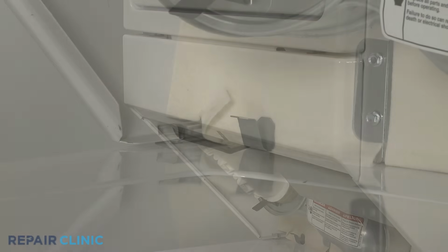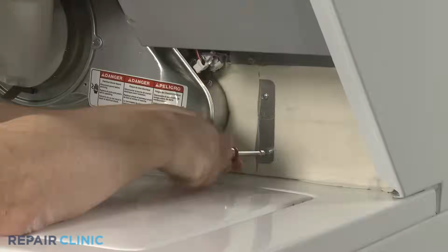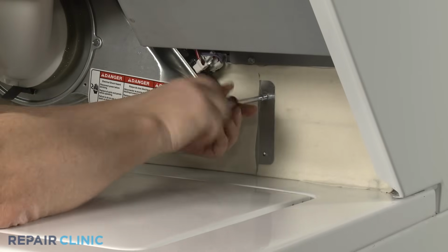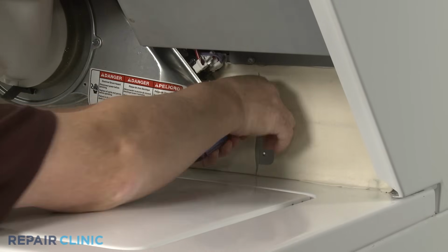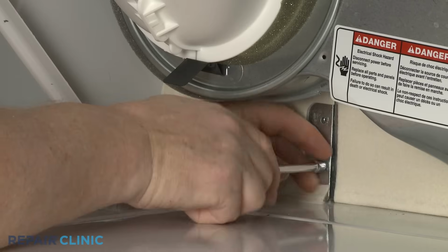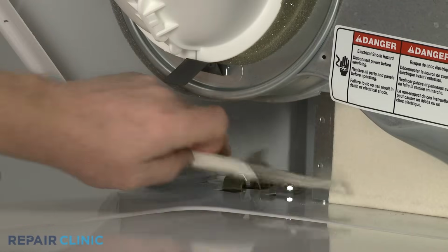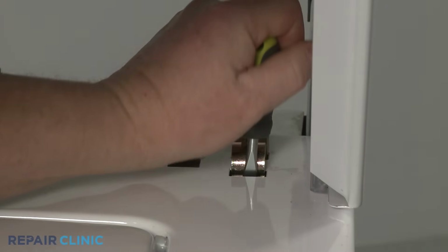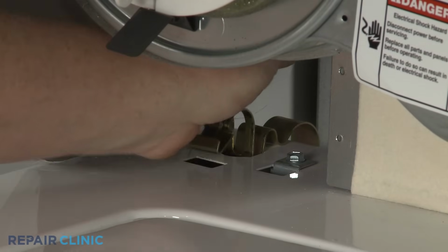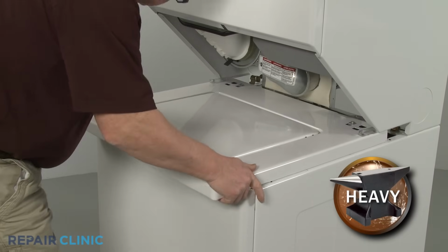To uninstall the washer's top panel and lid, first remove the 2 rear access panel clips. Use the 1/4-inch socket or nut driver to unthread the screws so you can detach the access panels. Use a short flathead screwdriver to help detach the spring clips securing the washer's top panel and lid. Pull the top panel forward, then lift up.